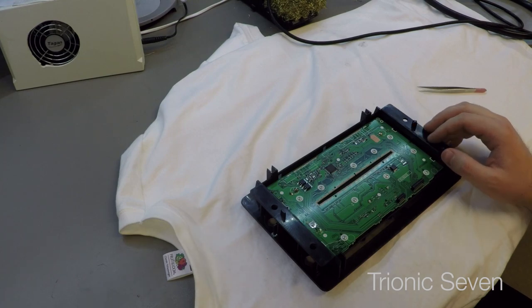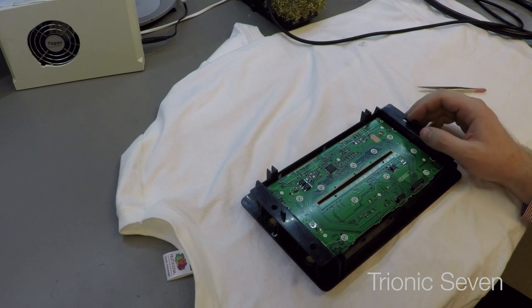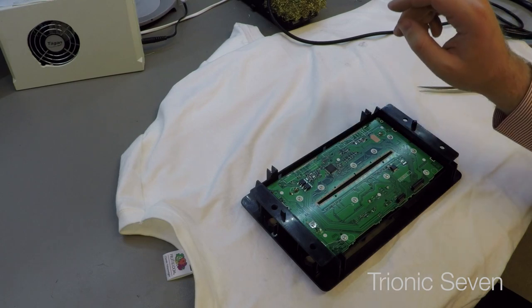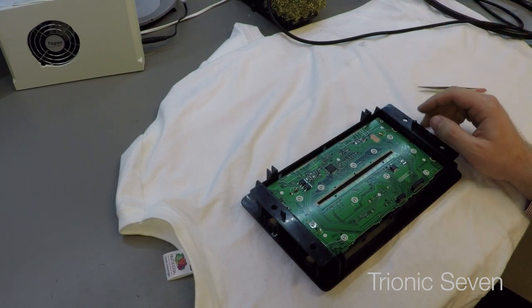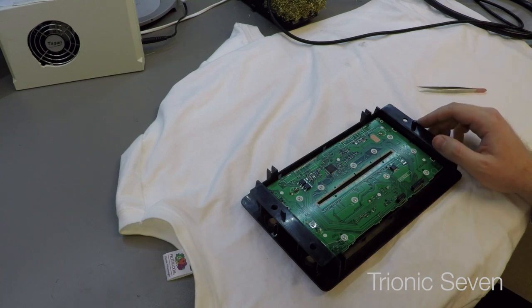For some reason Saab put a voltage divider on the auxiliary input ports which reduces the input amplitude by around five times. This was probably done 10-12 years ago when MP3 players were dominant — they might have been noisy and caused problems, so they reduced the input level. Now we have phones and we want high output volume, so we want to remove this voltage divider too. Right now if I'm playing on auxiliary and switch to the radio, it's going to be super loud, so I have to pull the volume down before switching — which is annoying. You can stop here if you want; the next part will be more difficult, so only proceed if you feel comfortable.